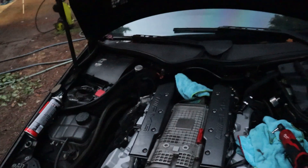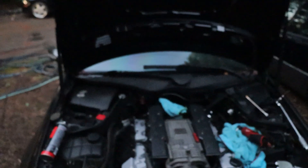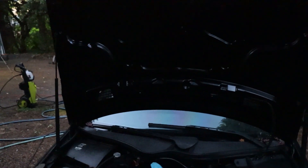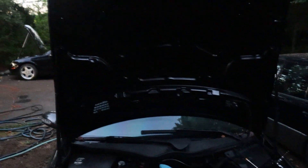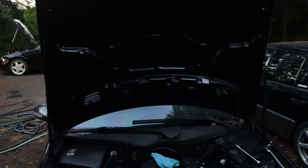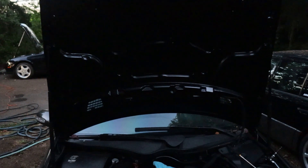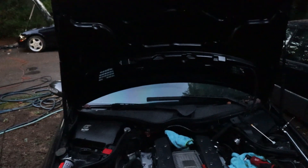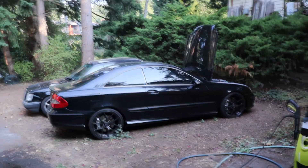I'm so happy to have it right here buttoned up — I don't have to have towels covering all these spots anymore. I am so pumped because this means we're getting that much closer to firing this thing up. My plan tomorrow morning: finish the AN line, then hop into the fuel pump and try to swap in our Walbro 525. My idea for now is basically to run an electronic fuel pressure gauge to the cabin and take it for an easy test drive to see what fuel pressure looks like with the stock sending unit and stock filter with the built-in regulator.